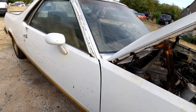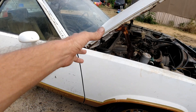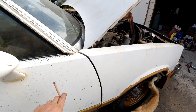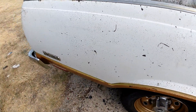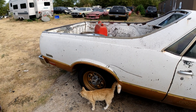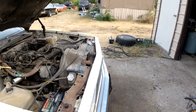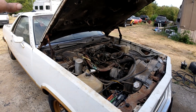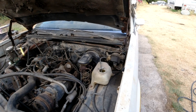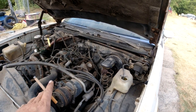We're going to do something a little different here. This has got the factory catalytic converter on it, and that's coming off regardless — I'm going to chop that off. It's like a two-into-one: left and right come in, come down, come out here. Looks like it was done before it was parked, but it's just a single exhaust. We're going to put headers and dual exhaust on it — maybe an X-pipe. The headers go on after the engine's in, so once this engine's out we'll take the exhaust manifolds off, stick the new engine in, then bolt up the headers.